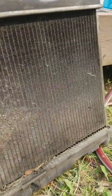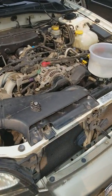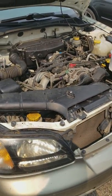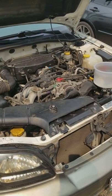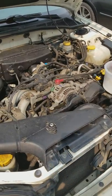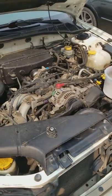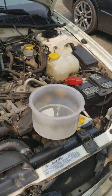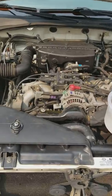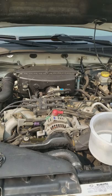The front side is caked. So if you guys have any Subarus or any other vehicle that overheats when you're going down the highway but doesn't overheat in traffic, just driving around or sitting at idle — be sure to check your radiator. Over time, without doing radiator flushes, gunk and rust gets built up in there and doesn't let it flow well. I just thought I'd make this quick video, hope it helps you all out. I spent a few days diagnosing this and that's what I found. All right, until next time.